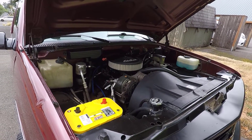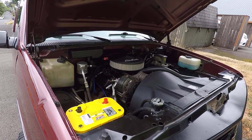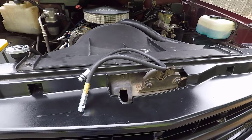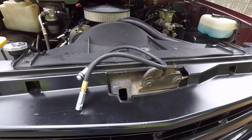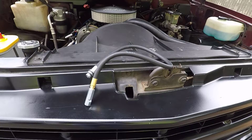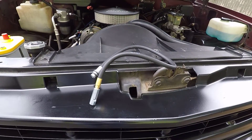While I know this procedure works with other engines, I'll specifically be talking about the Chevy 4.3 V6 engine because that's what I have in my truck and that's what I know about. A top dead center whistle really helps — you simply thread it into the number one cylinder and it whistles on the compression stroke and stops whistling at approximately top dead center.